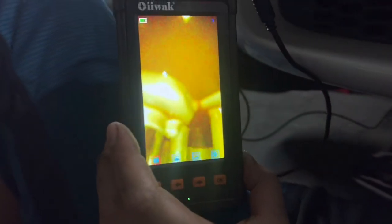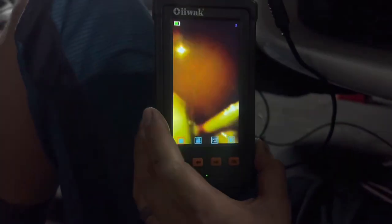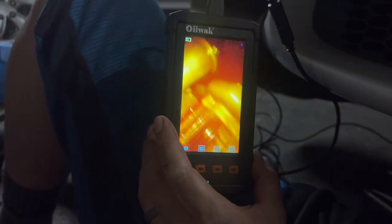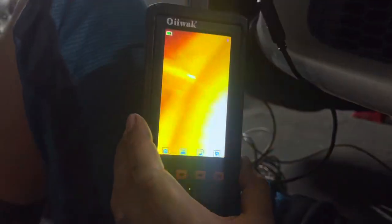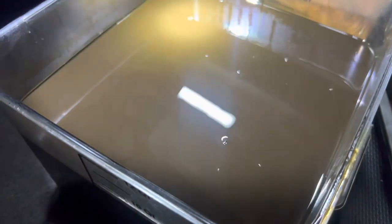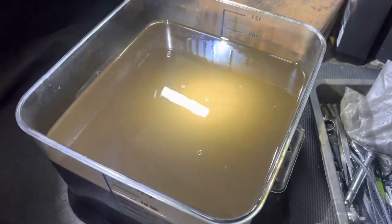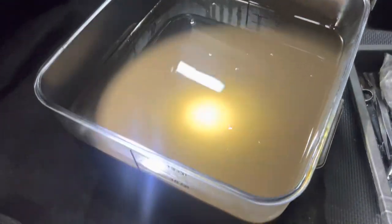I have the camera inside the oil pan. This is what the oil pan looks like right now — nothing really special, it's empty. This is the large oil pan. A couple of tubes here and there — that must be the oil pump or some kind of mechanism. This is the condition of the engine oil: it's not black, there's no metal shavings, it looks pretty good. Still lubricating and doing its job after 2,500 miles with the velocity stacks. Very good condition, no issues.